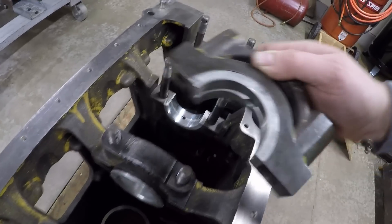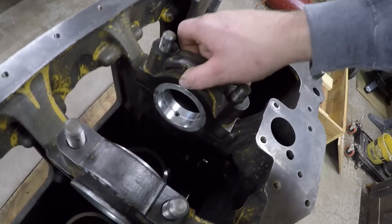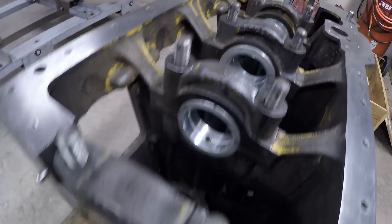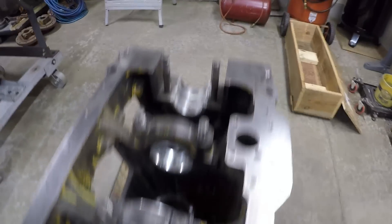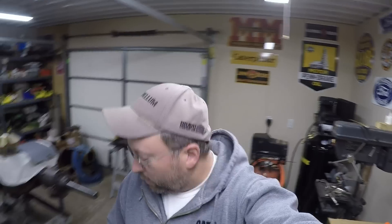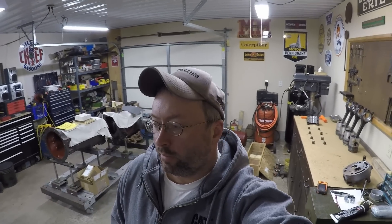All the shells are loaded into the corresponding bearing caps and I'm just placing these on to get a look at everything, gauging how it fits. We'll leave the big rear main cap out for now — it takes a puller to get it back out, so no need to mess with that just to look. Everything is fitting and looking very, very nice. Next up I need to work the crankshaft over, get it cleaned and polished, and start fitting it in there — see how it spins, see what our clearances are. That's the last leg of the process, and it makes me a little nervous because that's the best crankshaft I have and if I find a problem I don't have a great plan B. Anyway, that's gonna do it for tonight — thanks for watching, hope to see you back again.